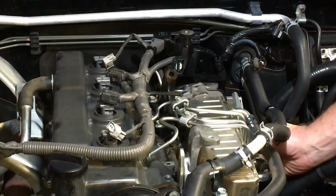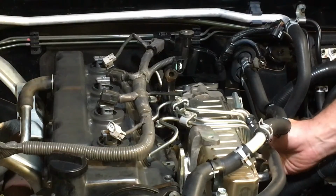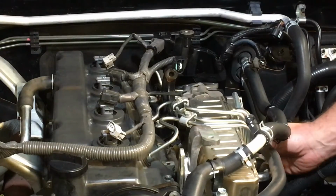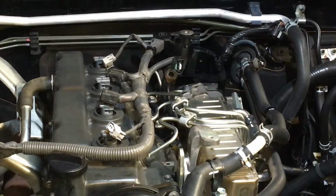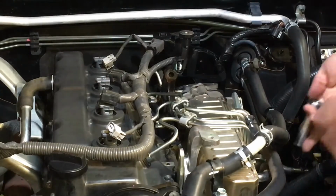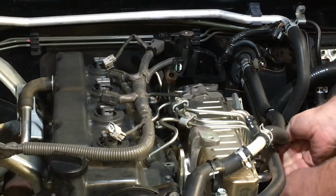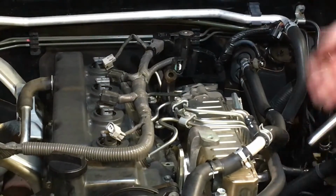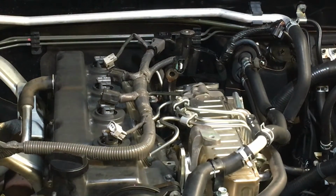You can see enough from there to find out where it is, right? If you can't, you need to be able to figure out some of the basics. If this video isn't enough for you, you probably shouldn't be doing it, right? So that's done up. I'm going to put the socket on and give it a good cranking. I don't use torque settings on this. It's probably 20 Newton meters. I probably gave it 30. It's tight. It's not over tight, and I didn't rip the alloy out of the manifold. It's not coming loose. That's all that matters, right?